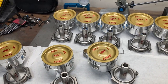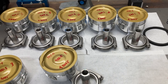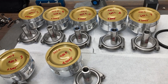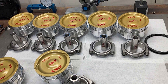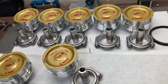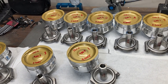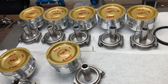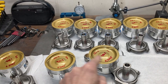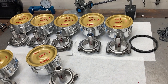We got parts shuffled around, measured and weighed, and I've got things well under a gram difference — that is tighter than good. Considering you have oil splashing around, you can't control the equal amount of oil that gets on each piston and rod assembly, so if you're at or under a gram, you're fine. I try to be as careful as I can when pairing things up so I don't have to drill or grind. I've got everything marked — for example, cylinders one and five paired opposite each other. Now I'll be hanging the pistons on the rods.